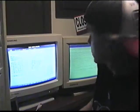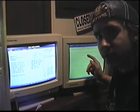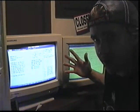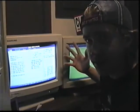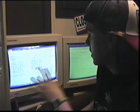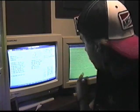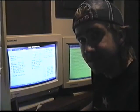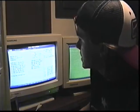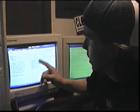There we go. You'll see here, this one's getting ungarbled. It's because this is a 70 Hertz monitor, even though it's supposed to be 60. Somehow it became 70 after a while. Weird issue. And it does not like anything 60 Hertz. So unless it's on 70, it'll be garbled like that. Not fun. No mouse in this, I'm stupid. It detects the drive, so that's a good thing.